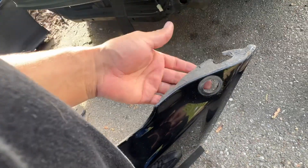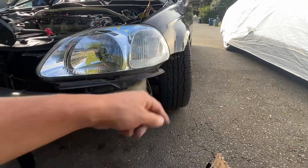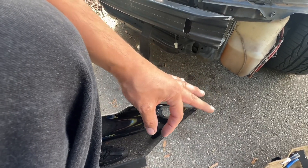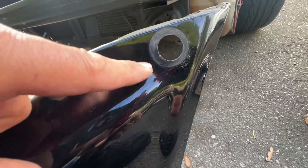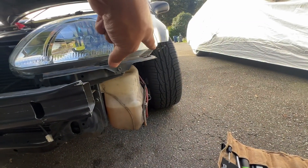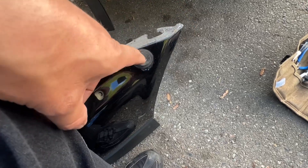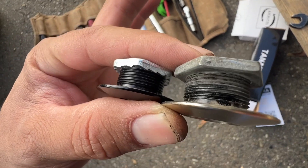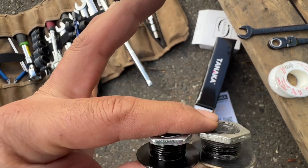How I measured this was I set it up to a decent point - I didn't want it too close to the edge. I also measured afterwards what was the closest point to the edge with the whole tab on there. I centered it around the bend, and then you're able to adjust the bar accordingly. Drill the hole and step drill until you're able to fit in one of the quick release tabs, then smooth out the edges with a deburring tool. They put a little bite in the washer - I was just going to use some Teflon tape, but it's been holding up fine.